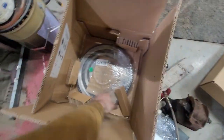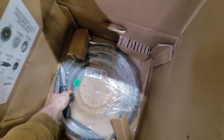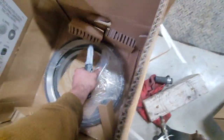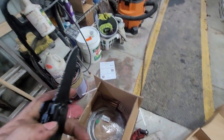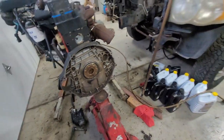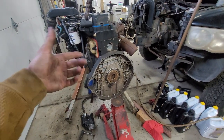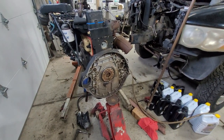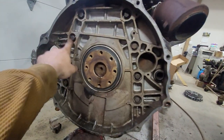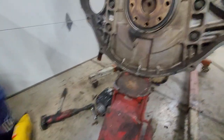Got that in and then we got the heavy sucker — it's about ten past fifteen now so I've got a few more hours. I'm going to head out and go buy my new truck, and then hopefully we'll go pick up the new trailer next week. New knowledge has been achieved: this is the adapter plate for the 12 valve to an NV4500 manual — it'll also fit your G56 or your NV5600. Now the problem: if you use the 12 valve one, see how you can use every one of the bolts.